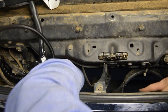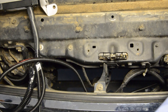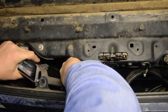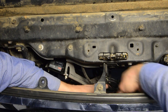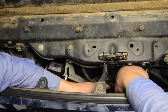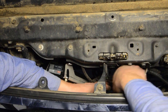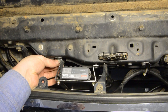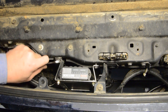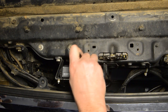Place the charger on top of the radiator support panel and run the cables across to the starting and auxiliary batteries and to the solar connection if required. You can then lower the charger into the gap between the grille and the radiator support panel. Using the supplied M6 by 20mm bolt and washer, loosely attach the lower mounting hole of the charger bracket to the captive nut in the vertical support member as shown. I'm also using this bolt to attach the earth wires for the charger and the Anderson solar connector. Using the factory bolts removed earlier, attach the top of the charger bracket to the radiator support panel. Once all bolts are installed, tighten them fully, and don't forget to reattach the horn. Make sure all your cables are well secured to prevent chafing.